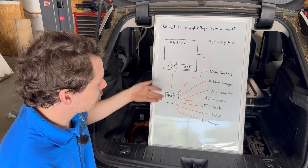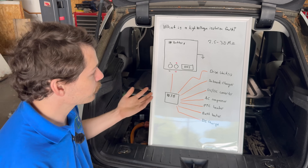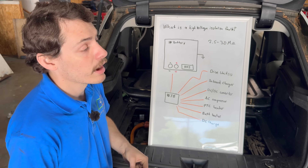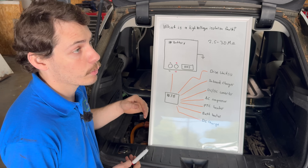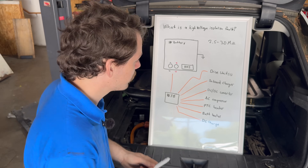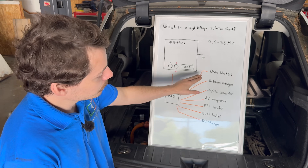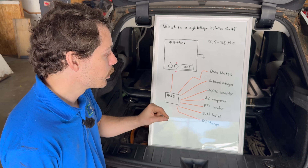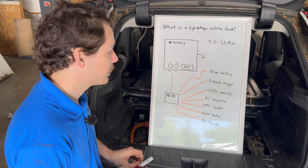To go through and actually diagnose where an isolation fault is occurring, the first thing you want to do — if there's a common failure point for your car — is go find that component. Make sure your high voltage system is disabled and isolated, then check your components to see which ones actually have isolation faults present. If you don't have a known failure point, you can start at the main high voltage cables where they connect to the battery and work backwards. Any one of these components will throw off your measurements for the whole system, so if you want to check any one component you need to make sure to either check it by itself or separate everything from each other to avoid false readings.